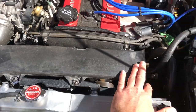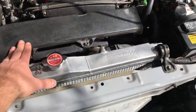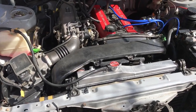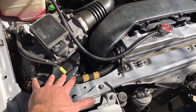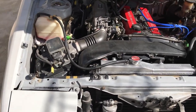You can see there's a lot of surface area which is definitely going to increase airflow. Let me show you guys the engine bay right now and what I'm talking about when it comes to accessing the dipstick. With the 86, you've got this intake tube right here blocking the front of the engine where that cool plate is that I want to show off. The dipstick is actually right underneath, which you can't access unless you remove this. It's only two bolts, not a big deal, but I want to make this car as accessible as possible, especially with the new engine — I'm checking the oil all the time. So this intake tube is going to be cleared out, and if the new intake has any gains, that's just going to be a plus.